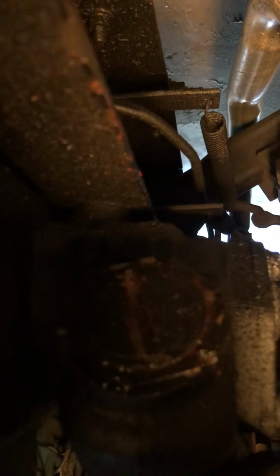By the way, make sure you jack up the front end of the truck and take the weight off the wheels before you do this. That's what's recommended on everything I saw online. So I did that, obviously, and then I put another chisel in that slot, put a crescent wrench on it, and tighten it up.